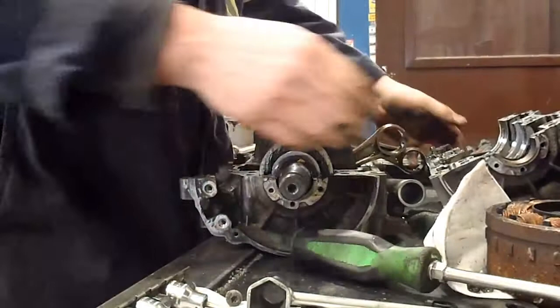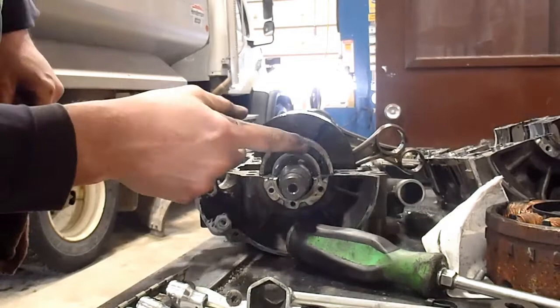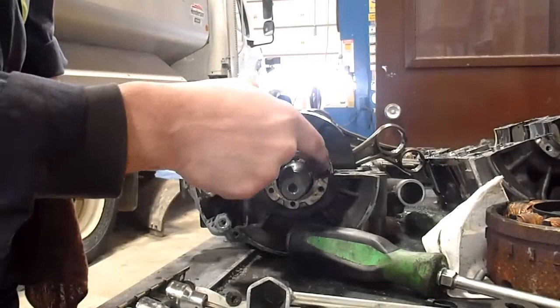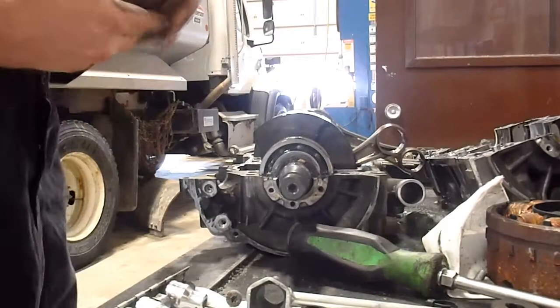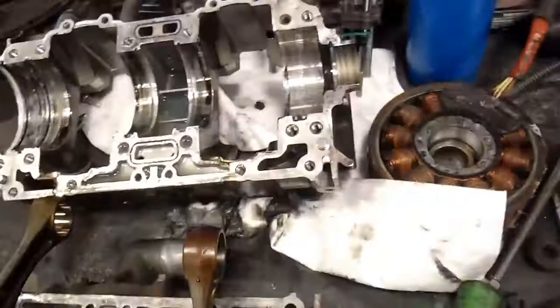That water pump cavity looks like it stays right full of oil - I'll show you that. I don't know what this brown grease is but I've seen that before. This is on the mag side of the crank and I've seen that on the forums - guys taking pictures of this. That's not isoflex grease, at least I don't think it is. I don't think isoflex turns brown like that - this is still transparent. So somebody possibly greased that with a different type of grease. You can see all the oil in there - the cavity is a full inch and a half deep of oil. On reassembly we'll take note of that - that's to lubricate the water pump drive gear I'm guessing.